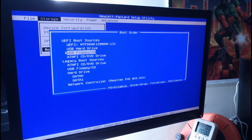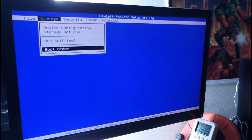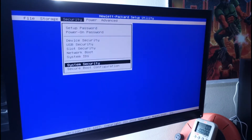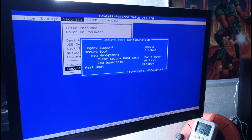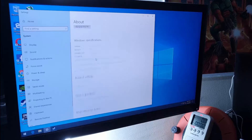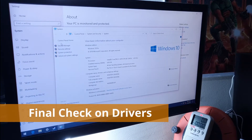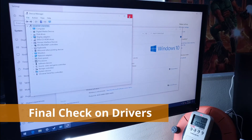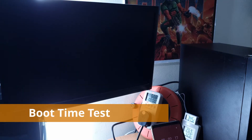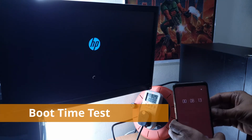All the unwanted devices will be disabled, fast boot will be enabled, and I will go through all the settings to check if there is anything else that needs to be done, after which I would save and exit. Then it's time for us to boot and start the real work. First we need to check that drivers are still there after the BIOS update. Then we check the performance options, set up the swap file, and then do a boot test to see how long it takes to boot.